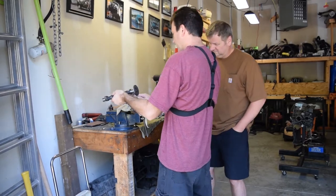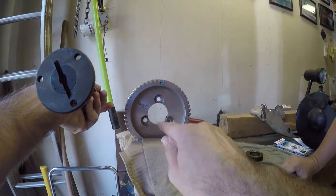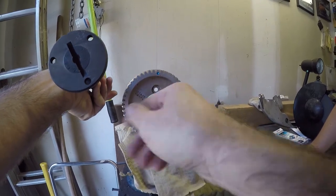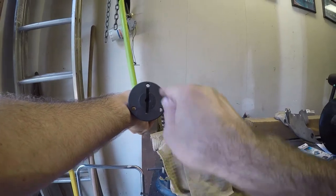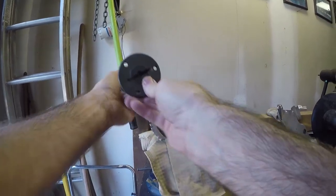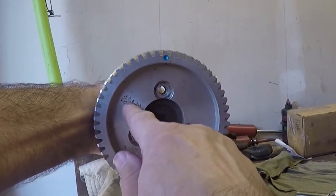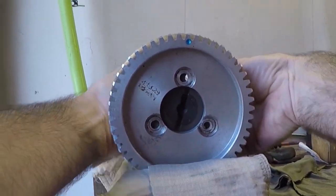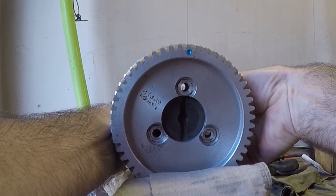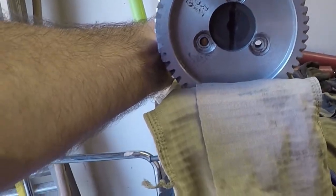We are going to notice the three holes and then the dot. We got the dot and it's over top of this one hole. You can see on the cam, it's kind of the same way. The cam will go together this way if you line the bolts up, but that's going to be wrong — there's no dot there. We're going to line it up with the dot, and that'll make sure that the cam is now clocked with the gear.